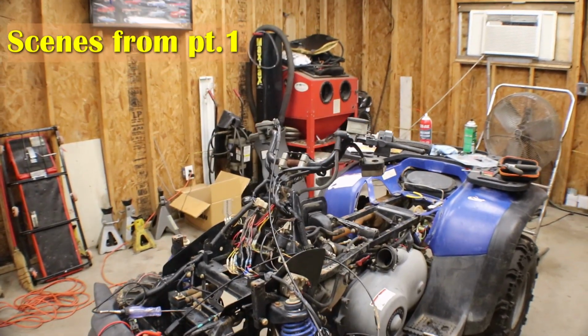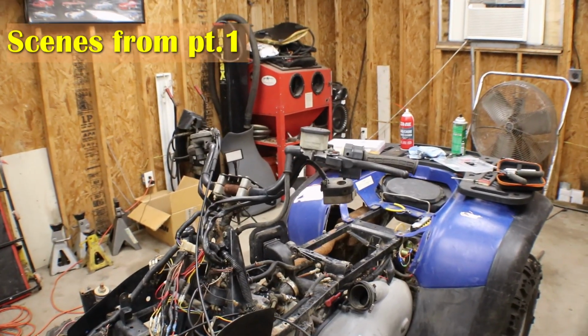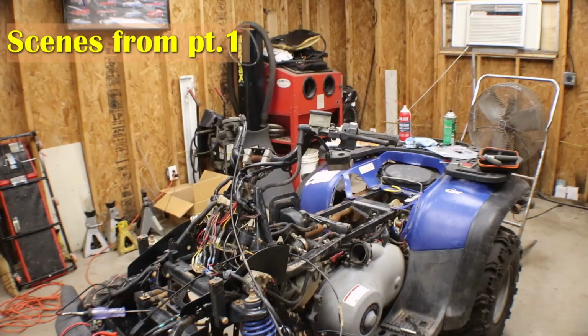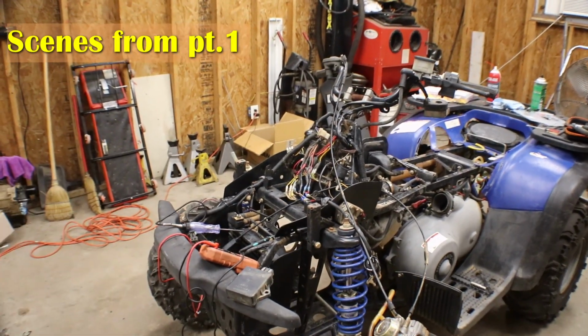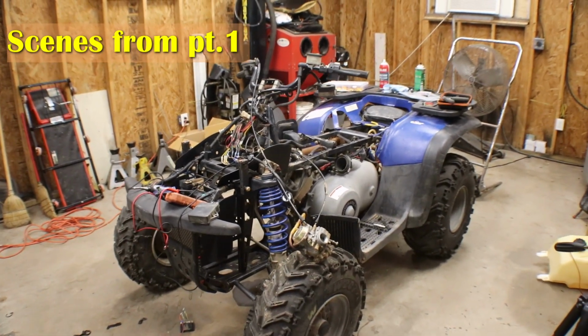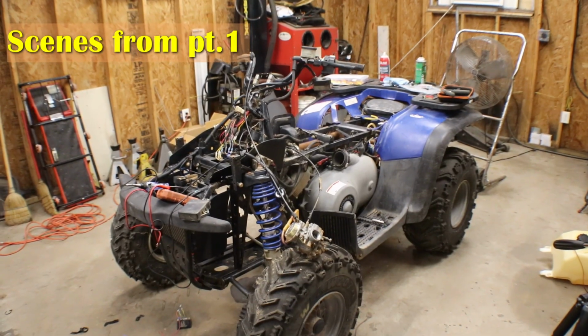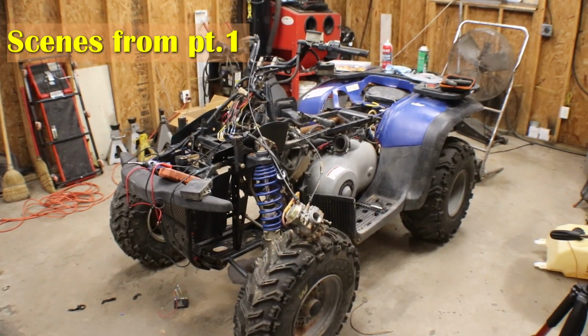If I can get it tomorrow, I'm gonna go ahead and just order a new handle. I really don't feel like taking all that stuff apart, trying to make that one work. But I am gonna go ahead and button that up, and hopefully we can get a carburetor on it. It don't have that much compression. Maybe the rings are stuck. Maybe we can shoot it with some gas or something, get it to fire up.